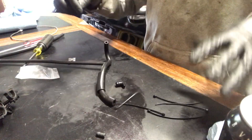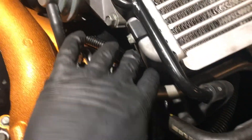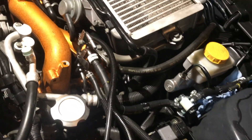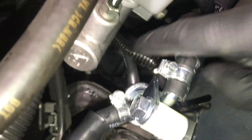We've got our new hose connected and teed, ready to hook this up. Since this line is going to be running kind of close to some things — right underneath the intercooler and hot areas — I went and found some sheathing and I'm just running some sheathing right around it. We'll tuck it in and cut it to length, and it will hopefully help with any heat that gets to the hose. Now we've got this side installed — I'll throw a zip tie on that real quick and then run this sheathing back over it to make it look nice and factory.